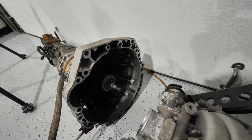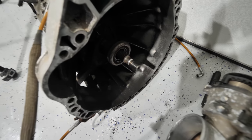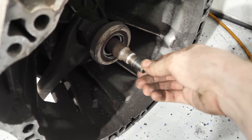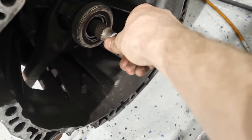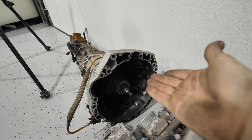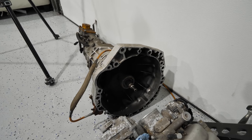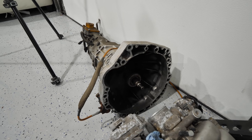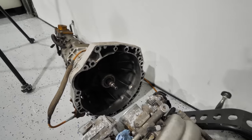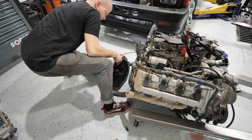I talked to my friend who's a big SR20 guy — this trans is totally shot. You can see how much play it has; it's got like an eighth of an inch of play in the input shaft, and the oil that came out was super flaky. We're doing all this work and it might just blow the trans next week, but I'm going to put it back in — I don't have a trans and I don't want to wait for one. Maybe that's a bad decision, but whatever.